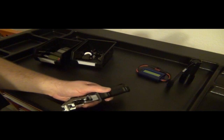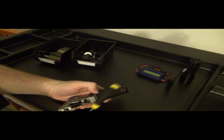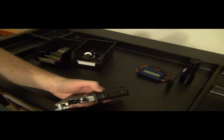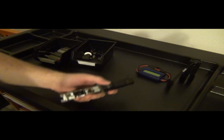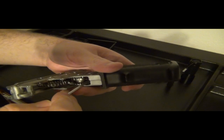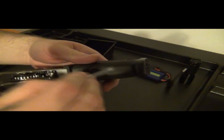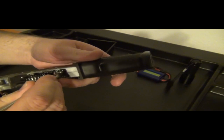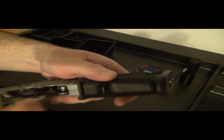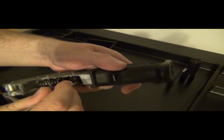If it's very resisting, it's very hard to turn, and that's exactly how the motor is going to have to turn that gear. As hard as it is for you to turn it, the motor is going to have to turn it. Because the pinion is bounded here, almost bounded, I mean it's so close, it's going to be the same torque for this motor to turn as you are turning for this bevel gear. The same. So you're measuring the resistance by doing this.